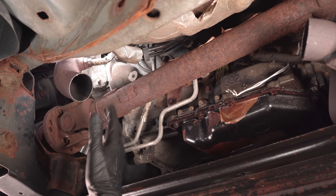So let's get the old stuff out. If I see anything interesting, I'll share it with you. Let's get this vehicle running nice and quiet again. Since I have the pipe out now, I might as well replace the O2 sensor — unplug the old wire, whatever's left of it, and clip the new one in to get it ready to go on the pipe. Make sure that clicks. Now that it's clipped in, I'm just going to hang it over here so it doesn't hit anything or get debris in the sensor part, and then I can put in the new exhaust.